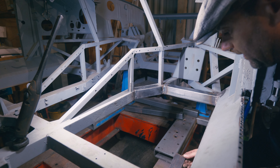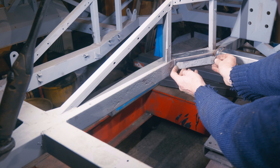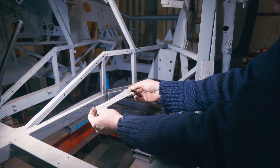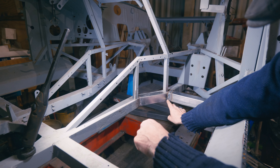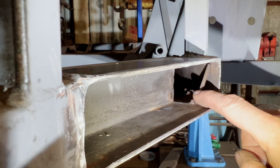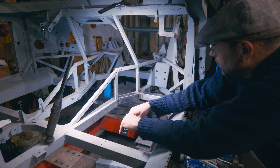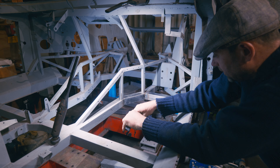That went up and through there. We had a bit of an issue up here - the front edge of that section had gone. I just drilled it out and got a nibbler in there and ran along it. You can see how peppered it is - I thought we ought to replace that one. What I found in here was a very big lump sticking up where they'd welded it. All the chassis welds were done with a big arc welder with sticks, and they got it down to a tee - some nice welds in here which we'll look at in detail.